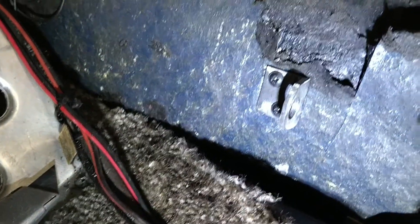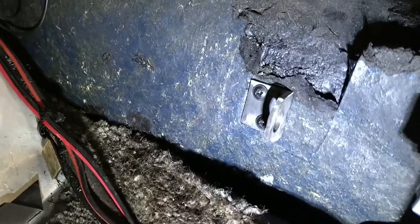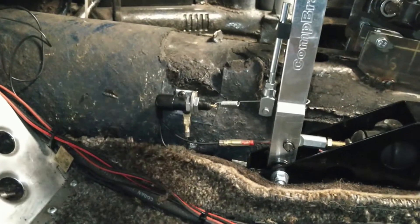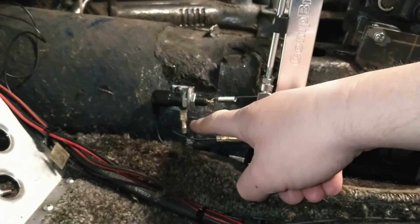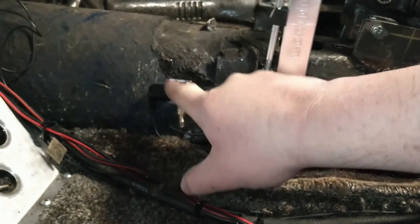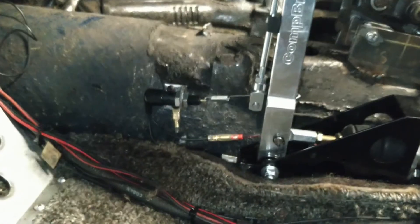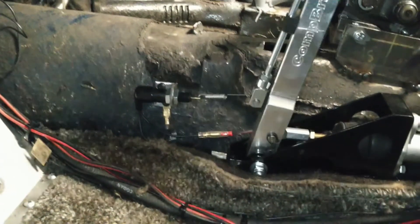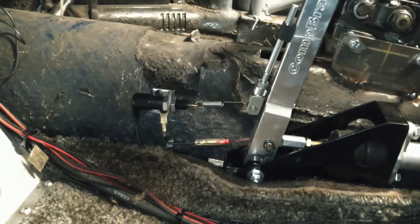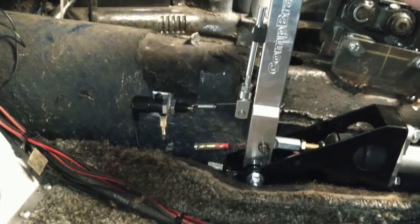It's got all this horrible tarboard stuff on it that I didn't want to take off, so yeah, it's in place now. There it is on its bracket — it's got one wire coming from the ECU into the switch, and the wire comes out of the switch and down to earth. So when I pull the handbrake it engages the switch and turns the launch control on; when I let go of the handbrake the launch control is off and away we go.